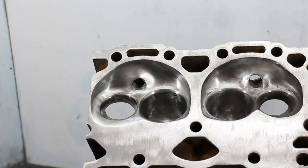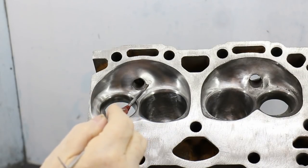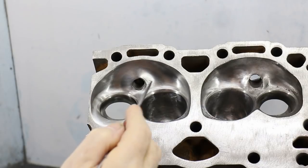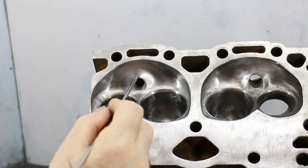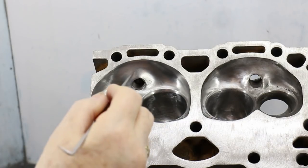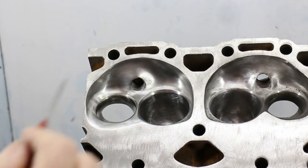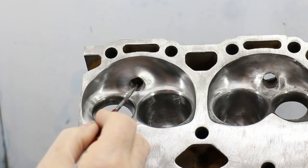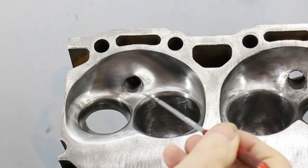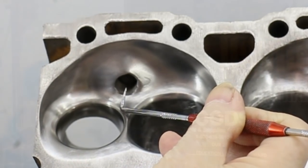The point here I need not to overlook: I've cut quite a bit away from the spark plug boss here. This actual deal here is about a thread and a half shorter than it was stock. So when we install the spark plug, we need to put two washers under the spark plug to get the body of the plug to be just here. Also, it is important that you use an extended nose plug — that puts the point of ignition right about where the end of my scribe is there. That's going to work for us.